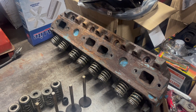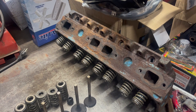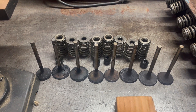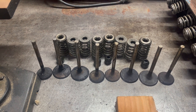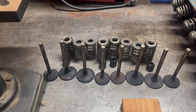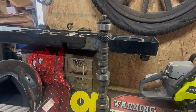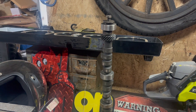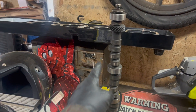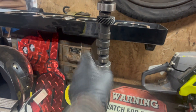This is a cylinder head. It's a very important piece of your engine — it does a lot of the heavy lifting. In your cylinder head, you have valves: intake valves that let air and gas in, and exhaust valves that let out the spent fuel. Those valves are opened indirectly by the camshaft, using a system of lifter, pushrod, and rocker arm, with the lifter riding on these lobes.